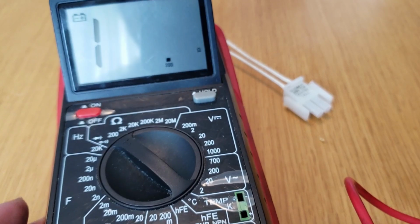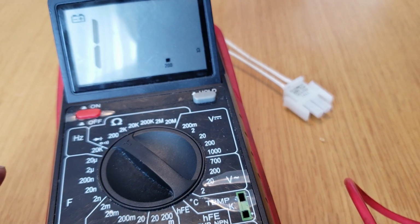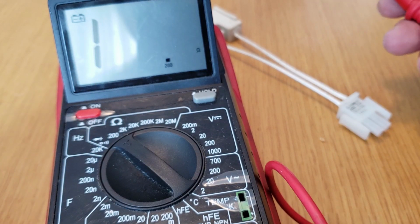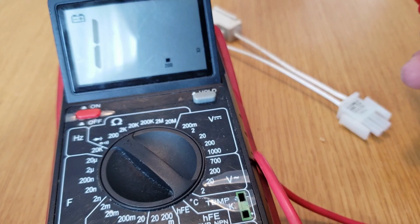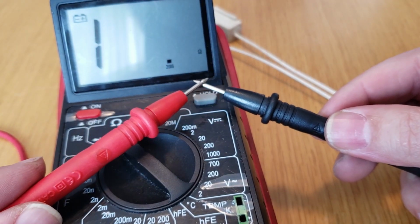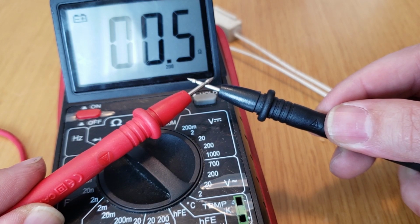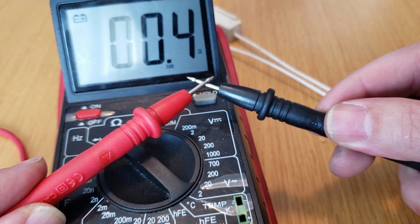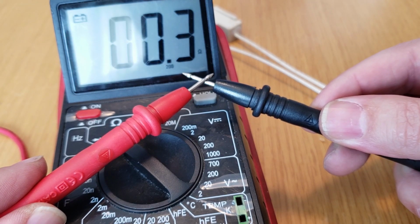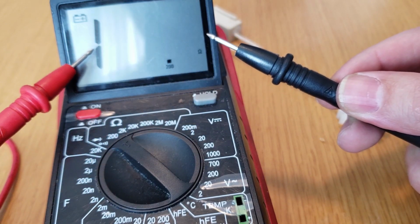So with the multimeter, we can set it to ohms. Basically, we're trying to see if we've got a loss of the signal or a total break, so no signal at all. If you're completing a circuit, you'll see the numbers go, and it should get really close to zero because we have a direct connection between both leads. If there is a weak connection, the numbers are going to go higher and higher until infinite. And when it's totally broken, this is what it'll display.